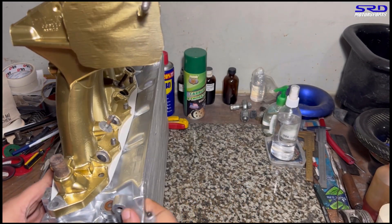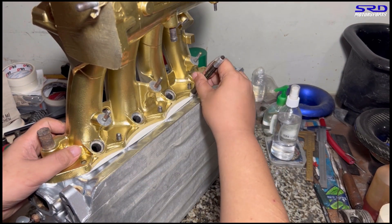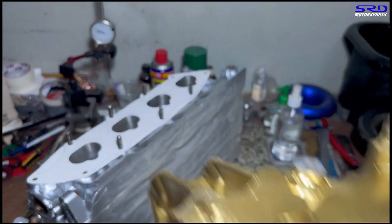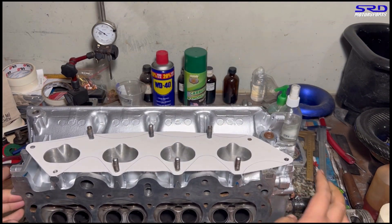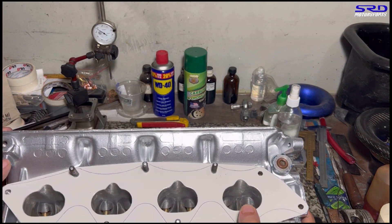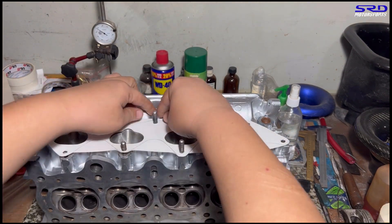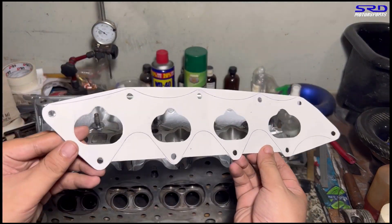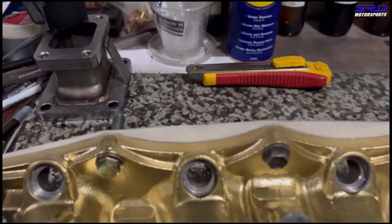Here we're showing you we're doing the outline of the flange so we can port match it better. We have a video about port matching and it'll be in the description below. Now you can see the outline for the flange is actually visible. We can bolt the gasket that we made onto the intake manifold, but we've got to be careful not to tear it up — if we tear it up we have to cut another one, and that's wasting time.